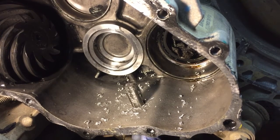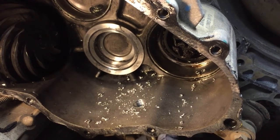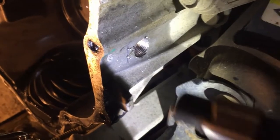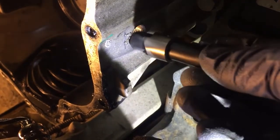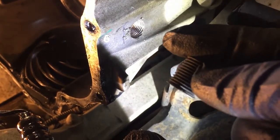Now I will screw it by hand. I clean this with compressed air, and I'm gonna run it through those threads again — it goes very easy — just to make sure before I insert that special sleeve. Now from the inside, we go from the bottom to the outside. I'm gonna use this extension and this tool, which is designed to smooth the first couple of millimeters of this rough opening, so the thread sleeve we're gonna install will fit there flush.